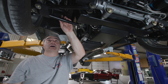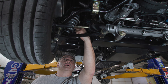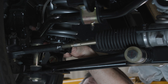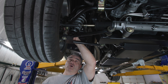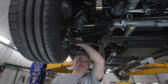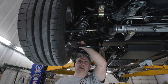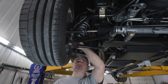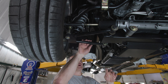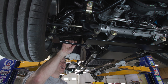As we look at the suspension itself, we use QA1 10-inch springs, double adjustable shocks, a Mustang 2 2-inch drop spindle, and Wilwood brakes. These Wilwood brakes are available in either four-piston or six-piston — the standard is generally four-piston. The upper and lower control arms are proprietary and go with our suspension as well.